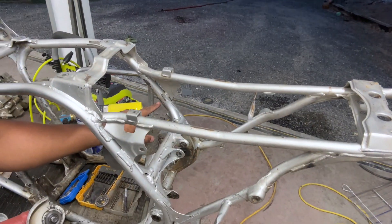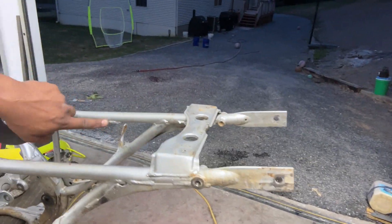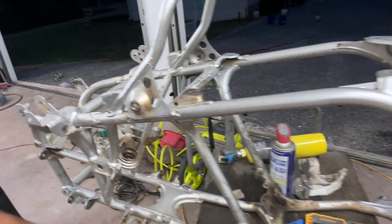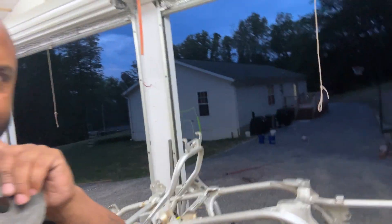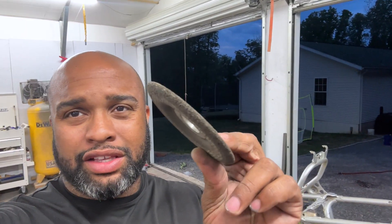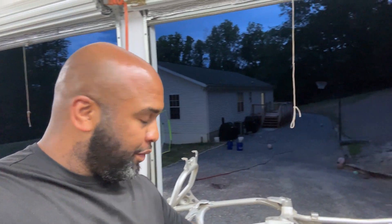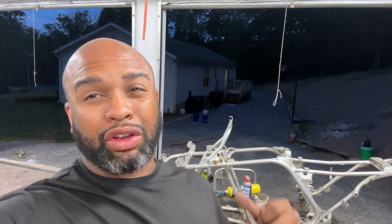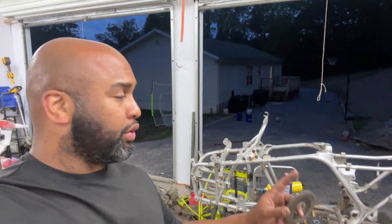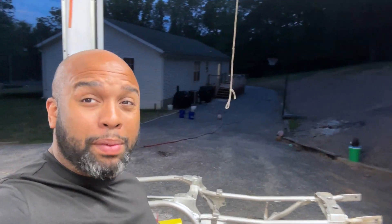We've done some hacking — tabs cut off. The one down here is gone, these ones here are gone, the ones down there are gone, up here gone, everything's gone. We're actually switching now from the cutoff wheel, which is the thin wheel that cuts metal, over to the grinding wheel, which has more texture and thickness to help clean everything up. Then I'll take a file and go over them to contour and get it nice and clean.